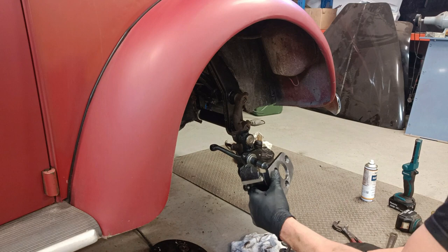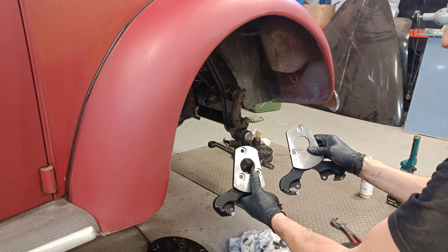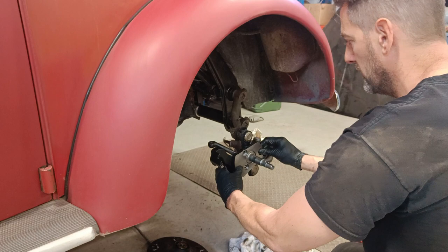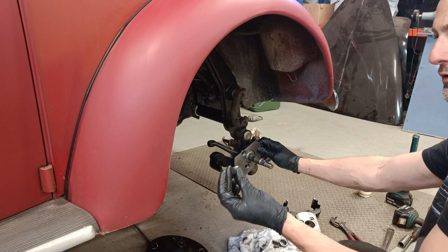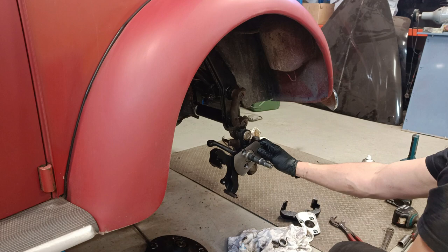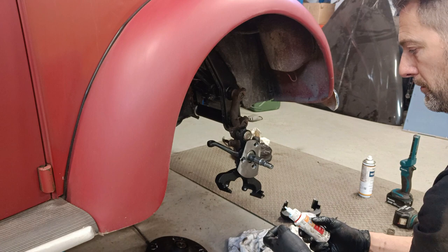These brackets are actually handed — left and right — because the bolt patterns are in slightly different positions. I just took these two spacers off; I don't think we need those. This faces on there like that. I did have a quick look at the instructions and it says for pre-65 cars, use the original bolts, and it's very important that you use hardened bolts. These are the originals, so these are good. I've cleaned the threads up because I'm going to use a little bit of Loctite — if the threads aren't clean the Loctite won't set.